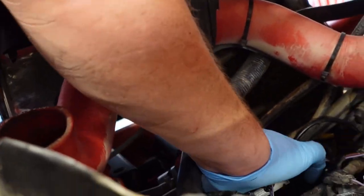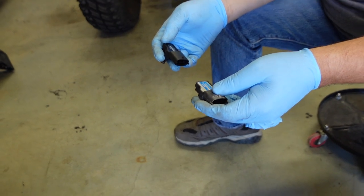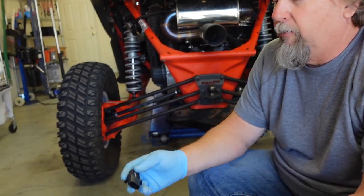We're going to assume he's putting the injectors in as they should be, and then we'll come back. Now we're going to change out the MAP sensor. When you're tuning a factory ECU, stock is say a 2-bar. Then as you go into higher boost, you go to a 3-bar, and then even higher boost, up to a 4-bar. The reason is because you're still faking it out — the ECU can't see those high boost levels, it's going to give you an over-boost code. So you go with a higher-bar MAP sensor and it makes the ECU see the same reading as if it's a 2-bar, but you're pushing out way more boost. I believe I had a 3-bar in there. Standalone ECU like the MoTEC will use any of the bars because it's just going to read what it's reading, but I'm just starting fresh with a 4-bar.